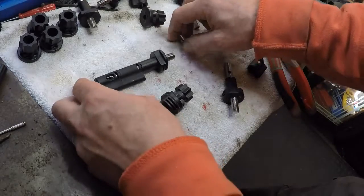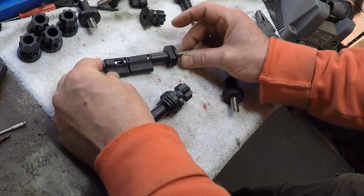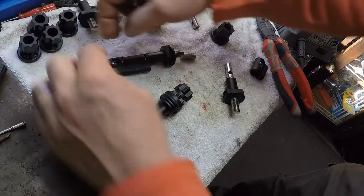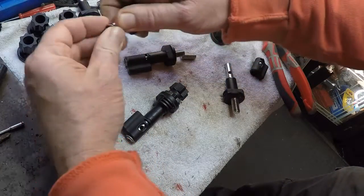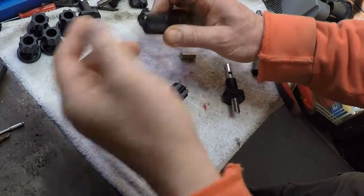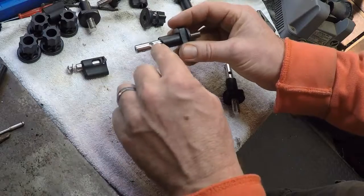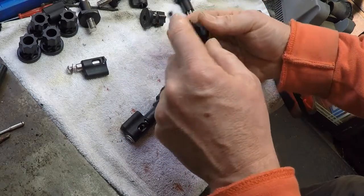I just want to show you what I started off with. The original Maxtrax latch is this long, with a little hex key at the end, and that's put in there with Loctite, so I just heat that up and unscrewed that. That enabled me to remove that bottom section. Then re-drill. I made another little hole here, so I had trouble threading that.